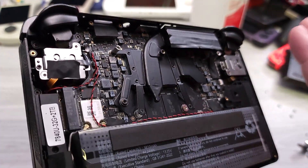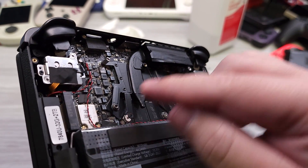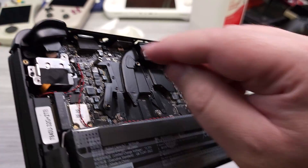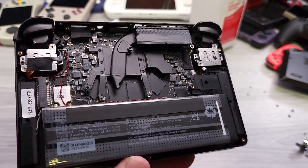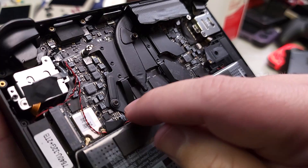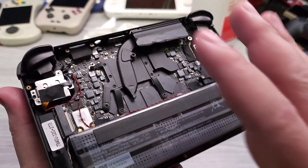You have to do this right — I've started screwing in one, but you don't want to screw all the way in. You want to do it in an X pattern: one, two, three, four — just turn each a little bit, then tighten them all so there's an even amount of pressure on the plate. At this point we've finished the install of the PTM7950. Don't screw in here yet — that's for the 2230 slot — we're going to put everything back together now.